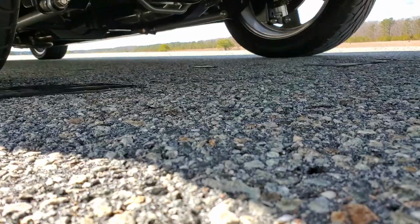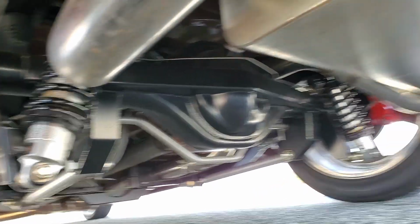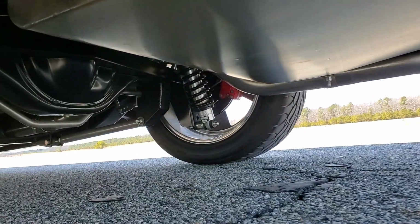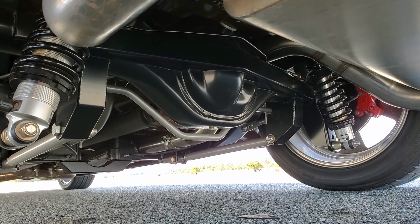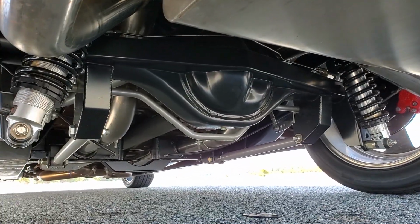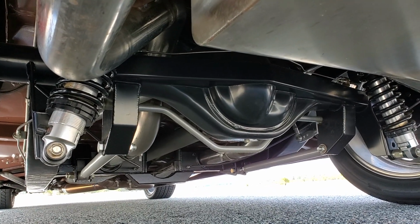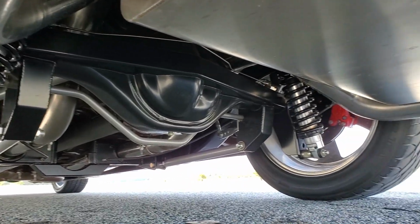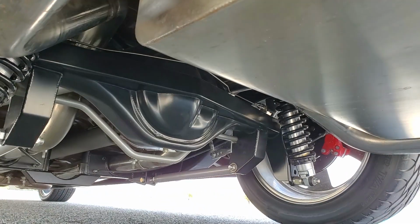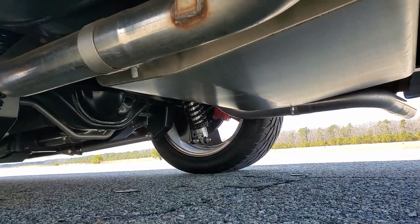It's just as nice underneath as it is on top. Whose tank is it? Stainless tank, right? Those aren't cheap. No, you ain't kidding. It's all Strange coil-overs, everything. Again, Art Morrison tubular triangulated 4-link. Full box chassis because it's from California, right? California tube chassis, yeah. So I want to keep that chassis. Really nice. They're a little more rare than the other ones. Nice sway bars, huge sway bar up front. Mandrel bent 3-inch exhaust. It's stainless, right? Stainless steel, yeah. Magnaflow mufflers.